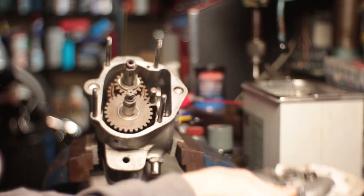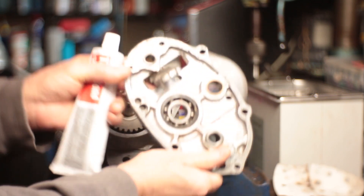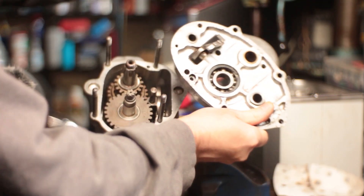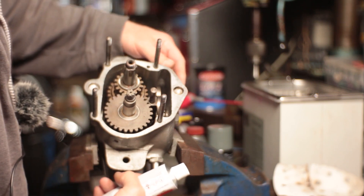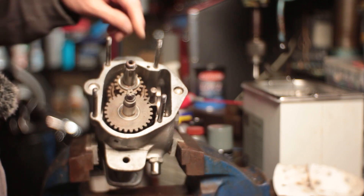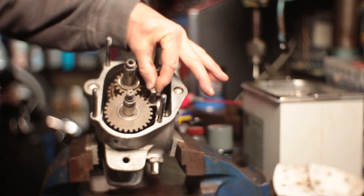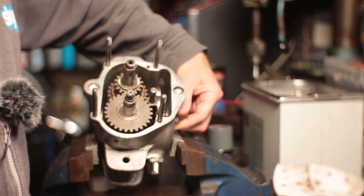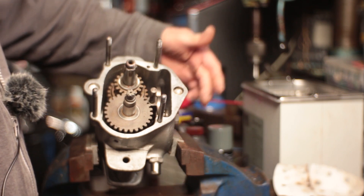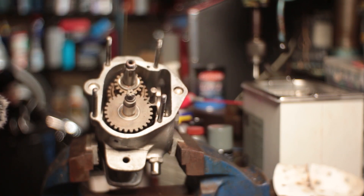Having read the manual a bit just to check, I knew where the indexing piece goes and there's a little mark here which I'll talk about in a minute. I've done a couple of things while you weren't looking: I've put the plunger in — in order to get the indexing lined up this has to be in neutral. I've put the little grub screw in that holds the rod in place that the forks slide up and down on, and I've also put the nut and the tab washer — I had to reuse the old tab washer — on the nut that holds the cam plate in place.